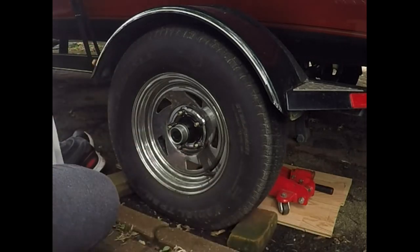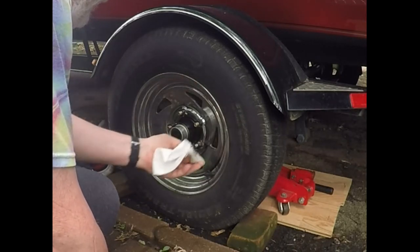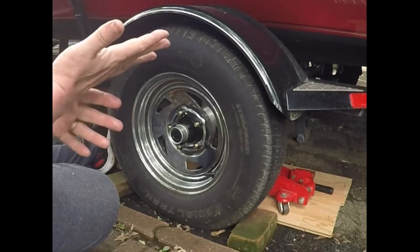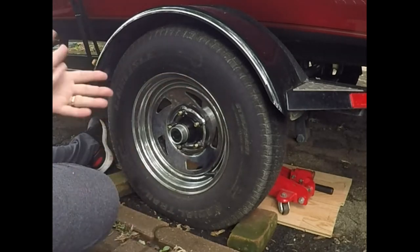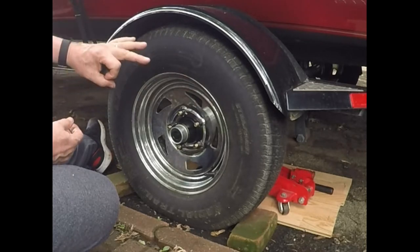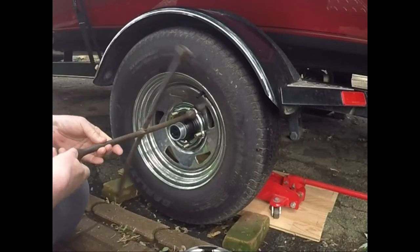So we've cleaned up part of the mess. Now it's time to clean up the wheel. One of the things I like to do is confirm that it's just the dust cap and not a bigger problem. So we're going to raise the trailer and take the wheel off to look on the back side. We want to make sure that the actual grease seal is still in place and not leaking.